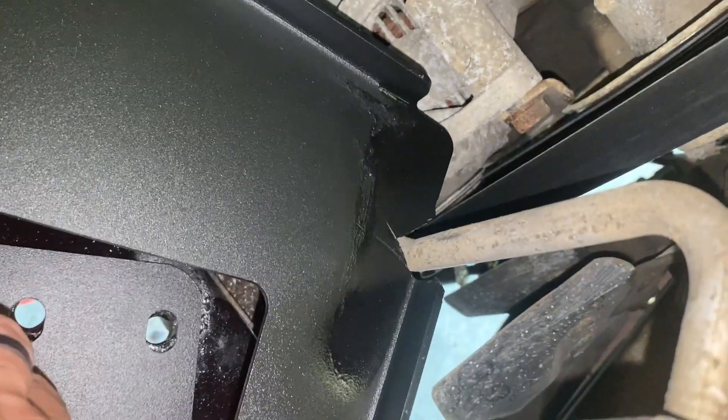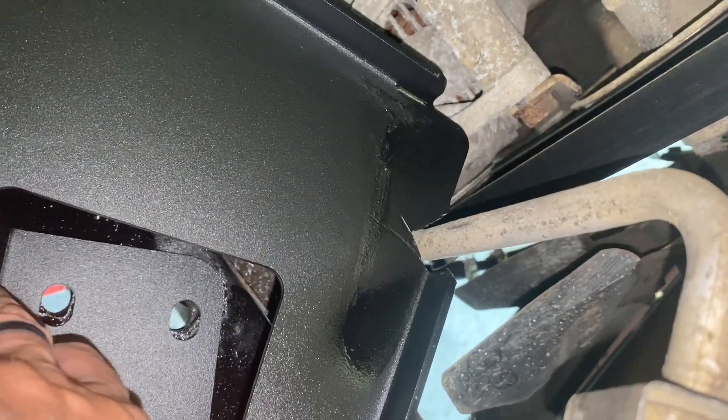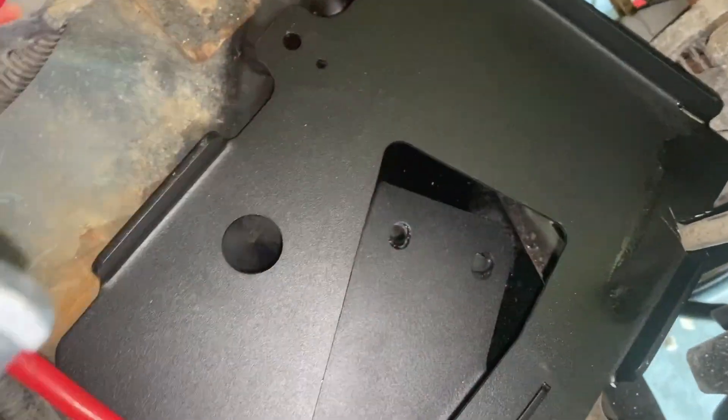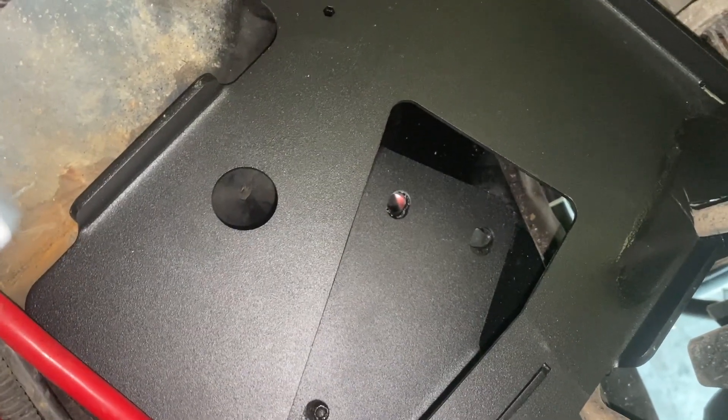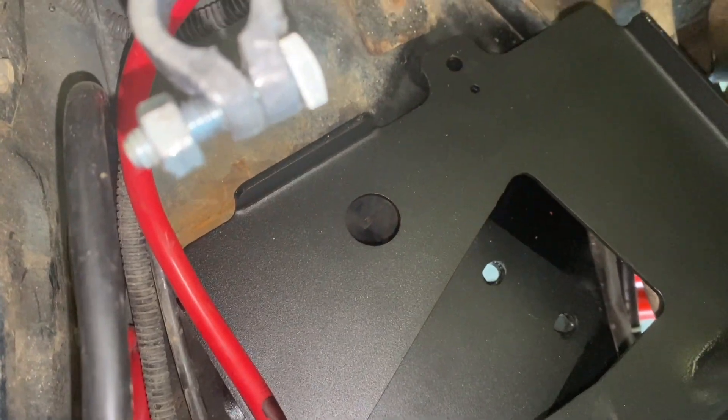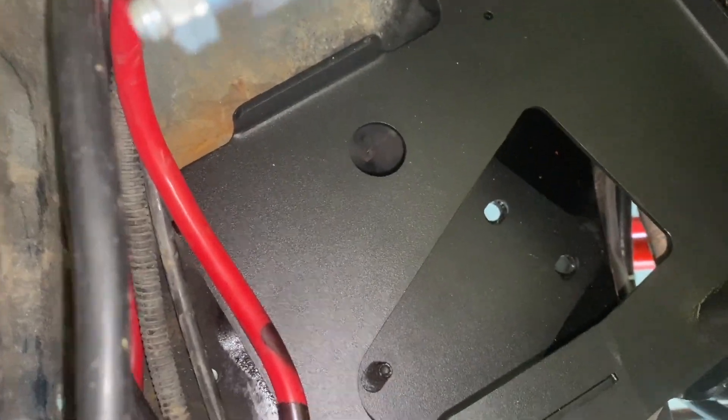As you can see, the tray is in here. I have that coolant line set up so it doesn't rub and won't nick anything. Before you bolt this thing down, make sure you put your temperature sensor back in — feed it through the hole, clamp it into the plate, and plug it up. I suggest doing that prior to anchoring down the plate.